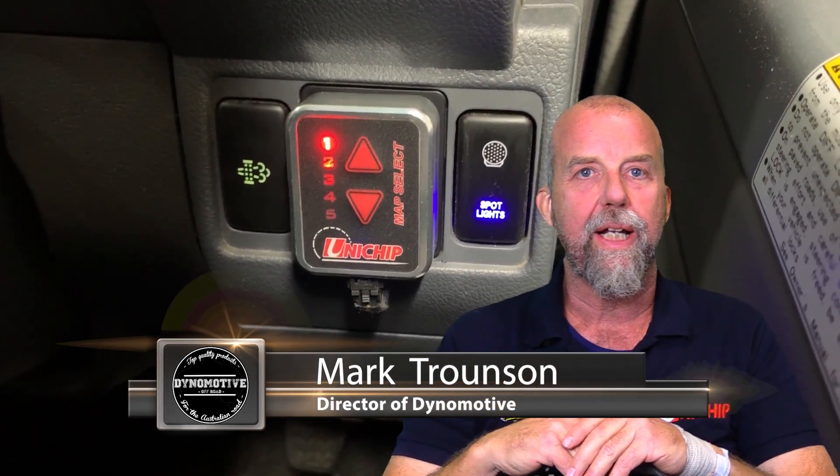With this car, it's very important to do the maximum and then work our way back through the minimums, and put the overheat protection in — we blend all that as we're going. It's quite an involved process with overheat protection on these cars. So it's wide open throttle for a sustained amount of time, making sure it bumps into the overheat protection and then that pulls the tune back gently. We make sure it's active, then we step into the next tune, because this is a multiple map scenario, looking at each tune setting and blending back until we get to all the different tune settings the customers ask for.